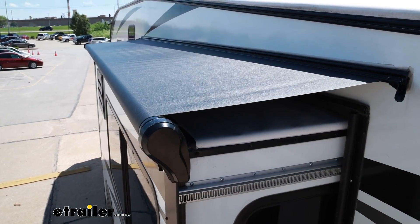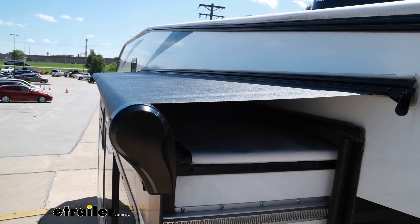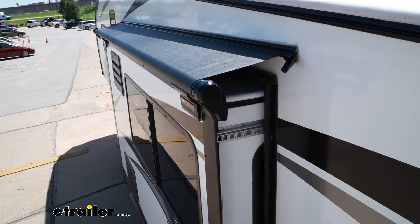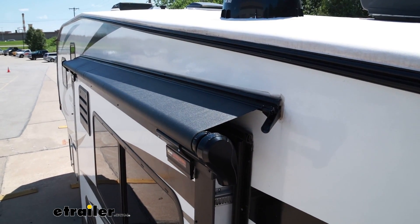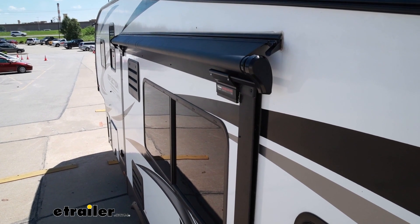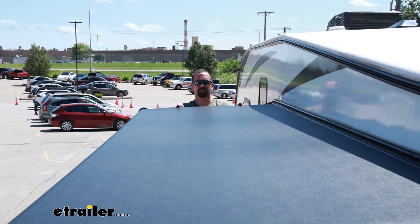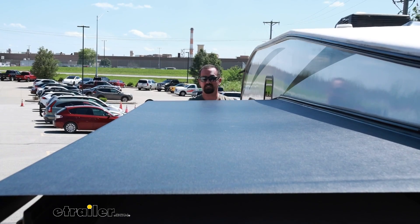The great part of adding these onto your RV is there are no mechanisms or power that you have to run to it — it just runs off of your powered slide. You'll generally have extrusion rails, at least on our Grand Design today, where we put the fabric in place. As that holds our fabric, it goes to our rollers, which are spring-loaded and mounted to the outside of the slide. As it draws out, it keeps nice tension so water isn't going to pool up — it'll all rush off. And as it draws back in, that spring-loaded arm keeps it nice and tight so it rolls up clean, and anything on top will just fall off.